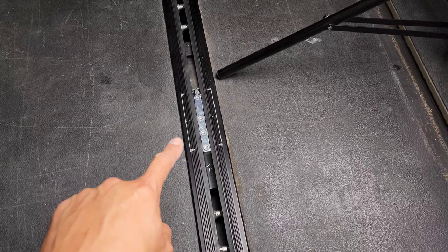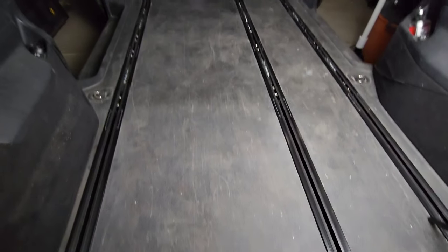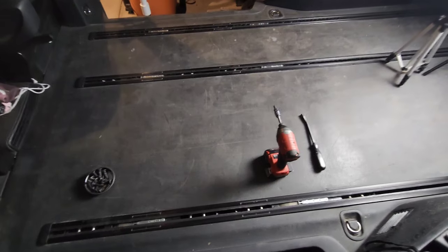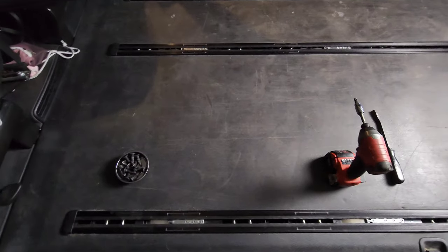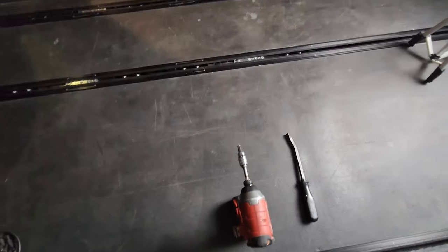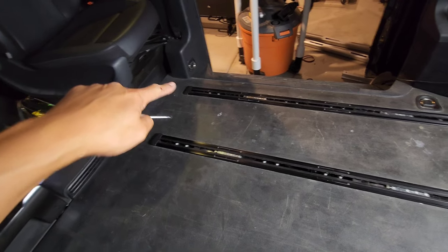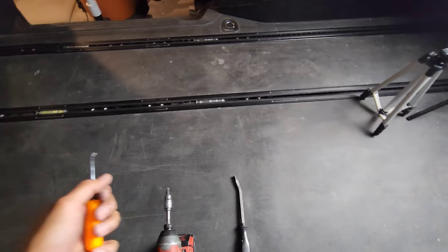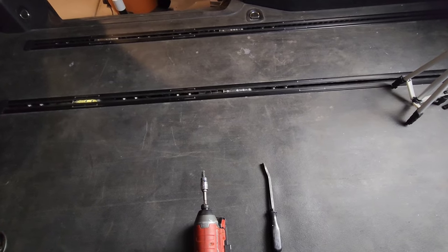I have the mounts — the box where they latch on — moved up front, so I'll go ahead and screw in the bolts in the back first, then adjust and move it around. One important key when installing this: I'd recommend moving your latches to the front. I only bolted in the first two bolts on each corner in the front and two bolts on each rail in the back. Then I'll install the seat, pull it back, get access to the remaining bolts, and tighten everything up.